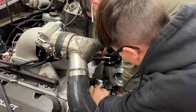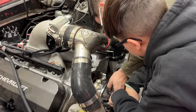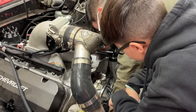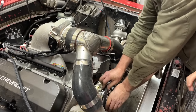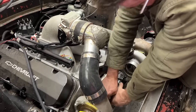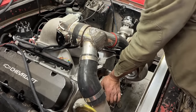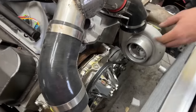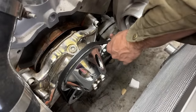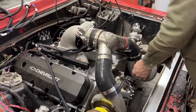So you wouldn't actually use this actual belt? Oh, I'll probably use it, yeah. Oh, okay. Sometimes it's easier to do the big pulley last. You can roll it up on it sometimes, like this. Get on that side and then... Come on, it's so close. This is a 15430 belt. There we go. Well, it looks like it lines up. So I guess it does work with a short water pump. So maybe a 440 belt will fit it. We now have a charging system that clears everything.